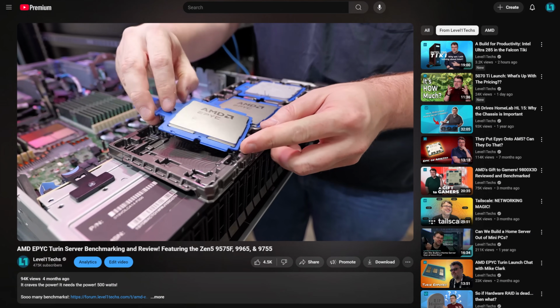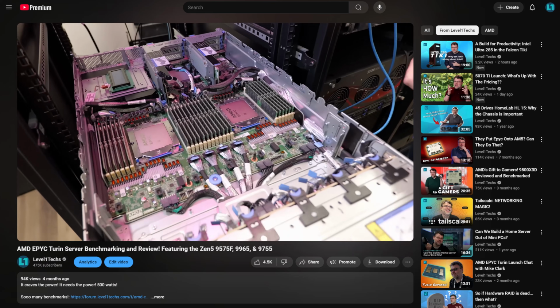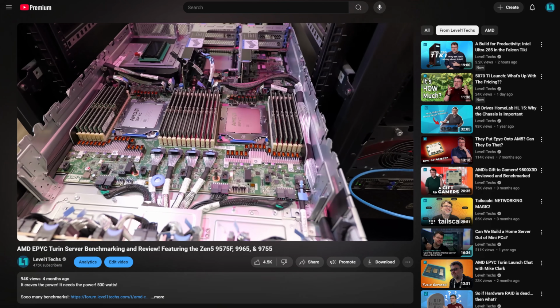Now, for the controller node on this, you can go traditional EPYC, AMD EPYC, especially the F-series CPUs. Those are a good choice. Just to see how much we can get out of it, I'm going to start by using a 16-core AMD EPYC in the AM5 socket. Yeah, the new AM5 EPYC CPUs. If you're just using this as a backup server, the 16 core will get it done. 96 gigs of memory, you can get a lot done with that. And so we're going to roll with that for our initial setup and our benchmarks.